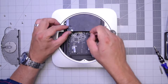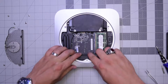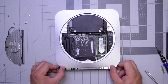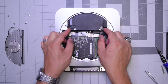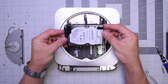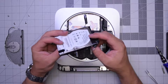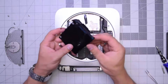With those six connections disconnected, push on the heat sink while holding the case and the logic board should pop out just a little bit — about half an inch to an inch. Now go ahead and pry the hard drive out. If you're doing an upgrade, you'll need to remove some screws, some of the tape around it, and transfer over the general connector.